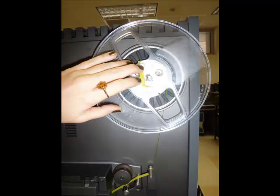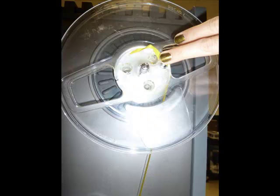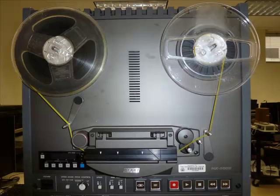Pull the tape over the top of the reel. Bring it over the top from the outside. You'll want to come up from the bottom right and over the top to the left. From there, you hook the tape, hopefully with leader, into one of the round cutouts made in the reel to hold the tape. Hold it there while you turn the reel to the left 1 or 2 rotations so that the hold keeps and the tape stays in place so that it will be able to wind mechanically onto the reel. When the tape is properly in position, it should look like this.